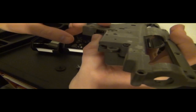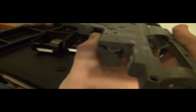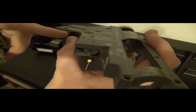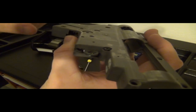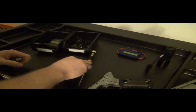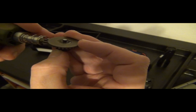And your gear should look parallel. Once you put the pistol grip on and you put the motor in and you adjust, it will go in and slightly press the bevel gear up the closer and closer you get, especially if you don't have any shims on the bottom of your bevel gear here, because it will hit right into it. So to show right here, here's your bevel gear, and if I had this low, it will hit right into it. See that?